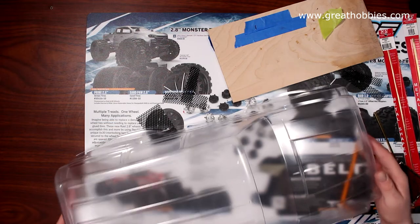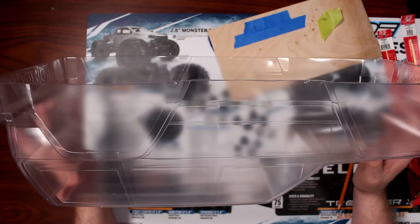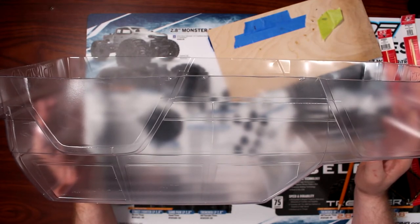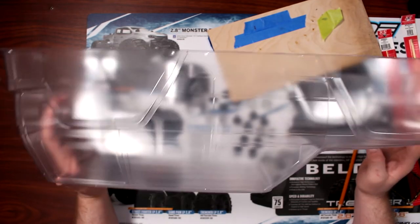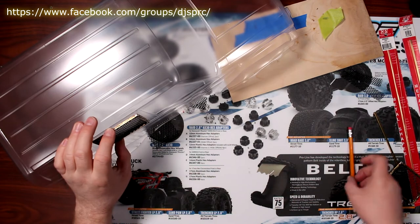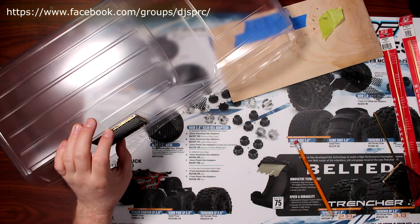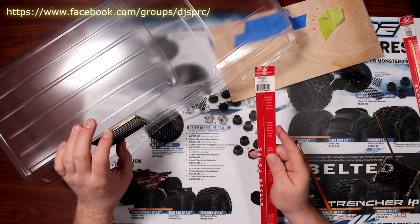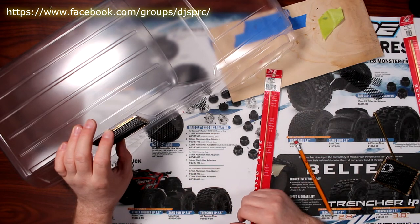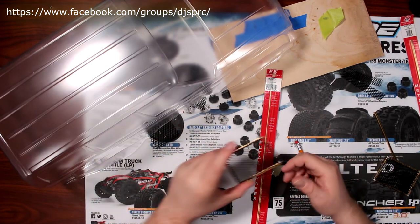Now, I'm not gonna do it on this body here, because this body here won't have this application on it. On the next video, you should be able to see the finished result on the body itself. I just don't want to show it yet. I'm not done with it. But like I said, popped it, drilled two holes, two holes, two holes, two holes here too, grabbed this K&S rod, bent it in half, and just twisted them inside. It holds extremely solid. Even if the body rolls, they don't move. And this is what I do all around it.